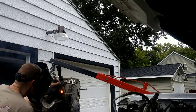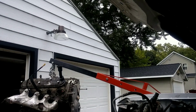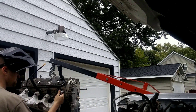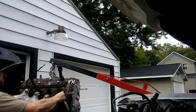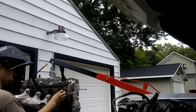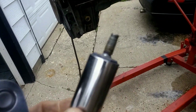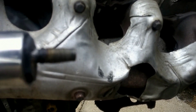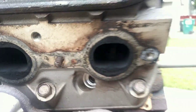You can see I am welding in that stud hole. What I'm doing when I weld in that stud is I'm building up material, I'm heating it up, and if there's any Loctite in there, the Loctite has now released because it's gotten hot. If there's any rust, I have now shocked it with a temperature change. If there's any other reason it's stuck in there, aside from a rolled thread, this will guarantee you getting the stud or broken bolt out. When you do this, you weld a nut on — you build up a knob, and then you weld a nut on top of that, and you're able to grab a hold of it and take it out.